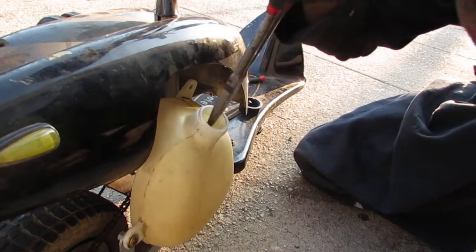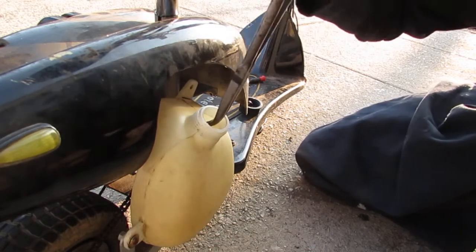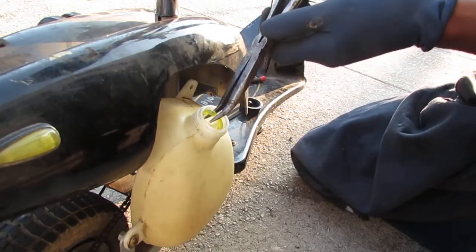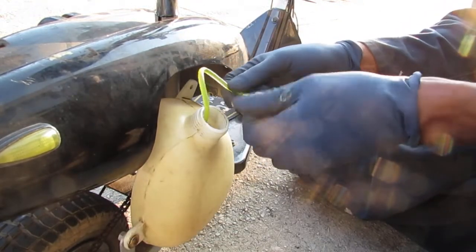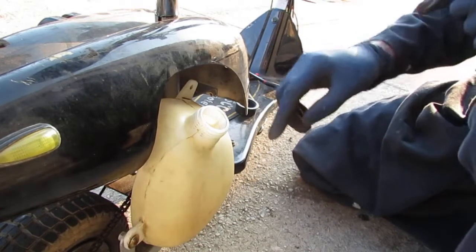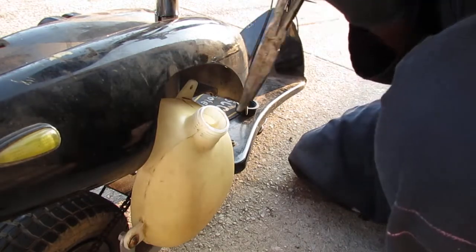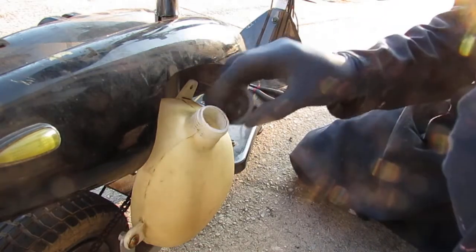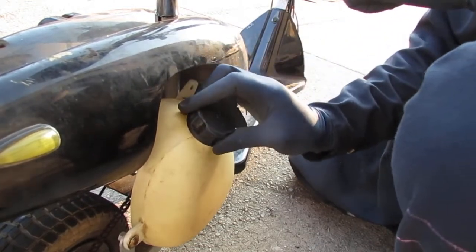Okay. All right. So the lower hose is the one that has the fuel filter on it, the one that's closer to the ground grommet. So here we are. That's our fuel filter. We're going to pull this off. Jam that in there. Running kind of low on fuel, so I have to be very mindful of that. That's going to affect things. So I'll probably have to mix up some more 25 to 1 so we can get a good testable sum.